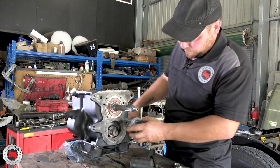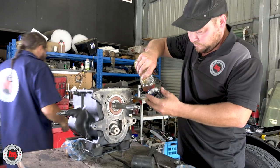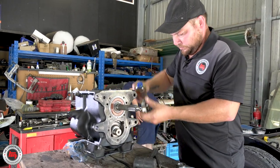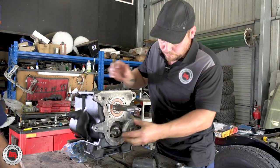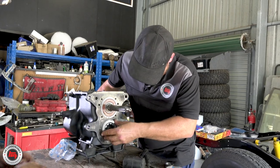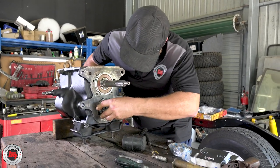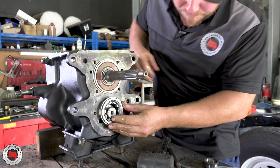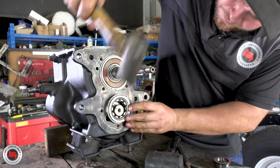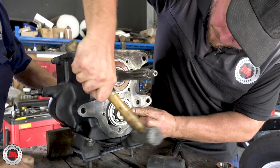What's that? That's the bottom bearing - the bottom bearing on the front of the gearbox. The race is actually part of the lay shaft, and the bearings are open - like an open needle roller. It's quite awkward to get the gears all meshed to get it up and pop that in. When it's awkward, you just get a bigger nylon hammer.